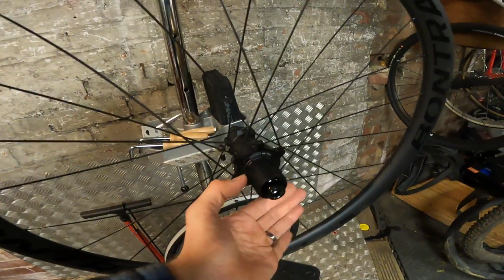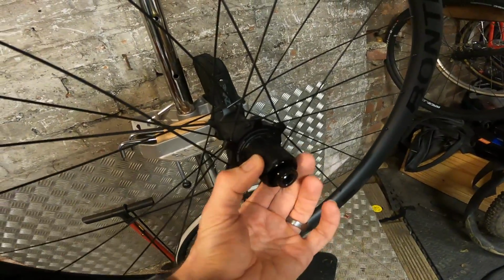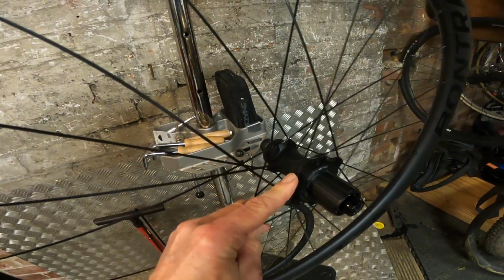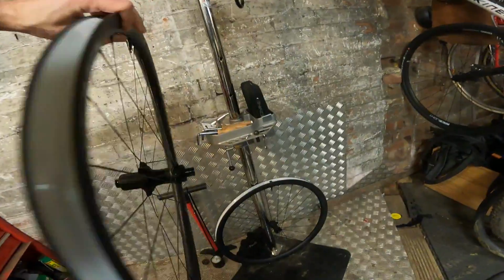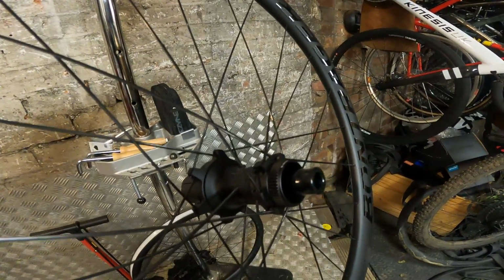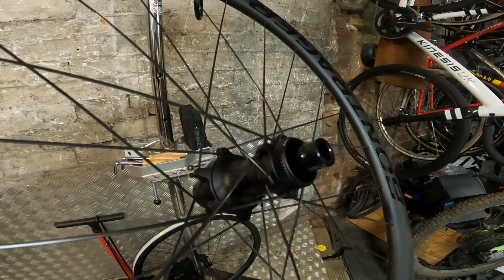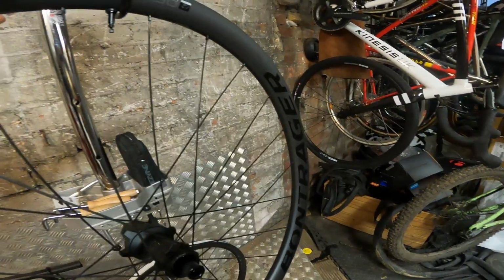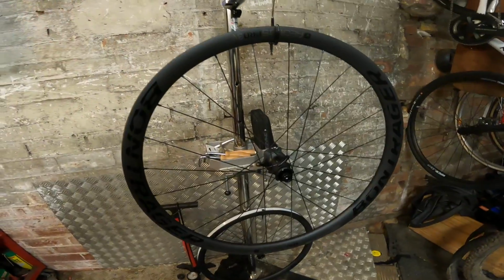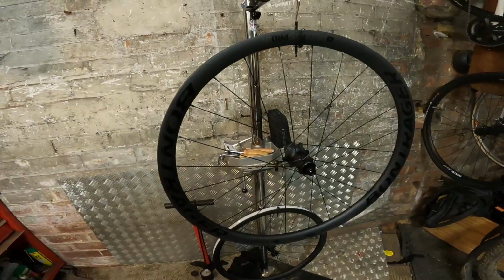But even on these wheels, you still get this Rapid Drive 108 rear hub, so you can hear that really instant pickup on those. As you can see, straight pull spokes, and then moving around to the far side, it's a Shimano centre lock standard. More and more wheels go into this now, both SRAM and Shimano, and most other disc brake people are now making a rim that's compatible with that. So it's wide, it's relatively affordable, and it's an okay, if not dazzling, weight. Let's get them skinned up with some tyres.